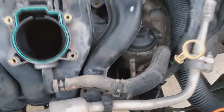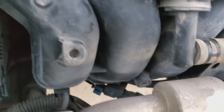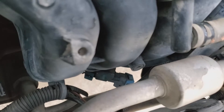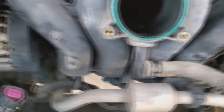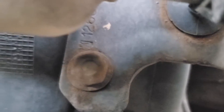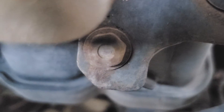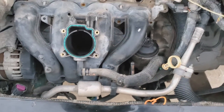Don't forget to detach the hose connected to the brake booster as well. Also down there, the knock sensor connector is attached to the intake manifold, so once you're able to lift it, or you can wedge your hands around there and unplug it before you try to remove the intake manifold. Down here you'll also see a 10 millimeter bolt holding down the AC line as well as the dipstick — you'll have to remove those so you can move them forward and pull the manifold off.